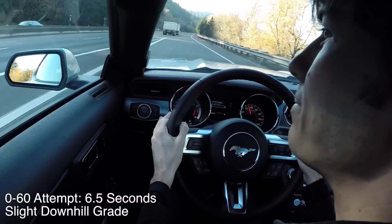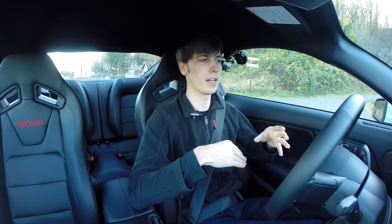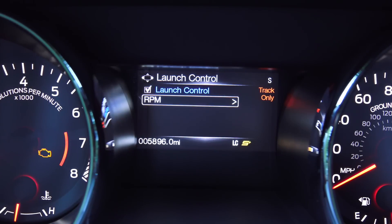Still had problems hooking up. So just for fun we're going to try doing this in 2nd gear and I'm going to raise the RPM for launch control to 3,500 to give it a little bit more power, since it's going to be at a disadvantage as far as gearing. Because we had traction issues with first gear, and also because we won't have to do any gear shifts during this test, it may provide a better time — so we'll see what happens.